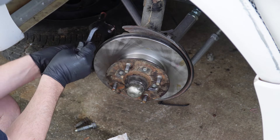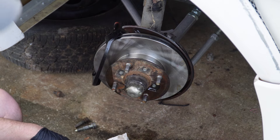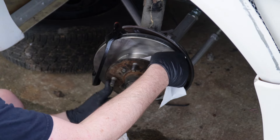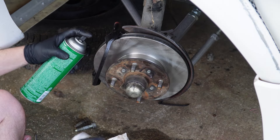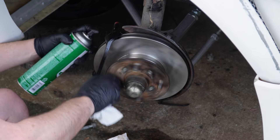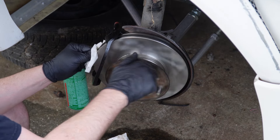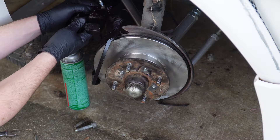As we go back together with the brakes, this is a good opportunity to paint your brake calipers and caliper bracket, or do upgrades like stainless steel braided lines. Brake rotors typically come with a grease or coating to prevent contamination and corrosion, so before you put your pads on, make sure to clean it off with brake cleaner on the front and back sides — otherwise you'll contaminate your brake pads and won't have very good brakes. Make sure to grease up your brake caliper slide pins with some good brake grease.